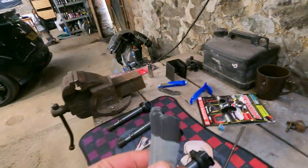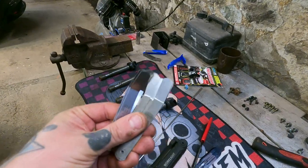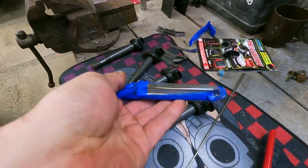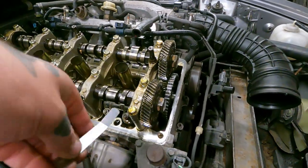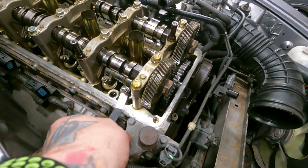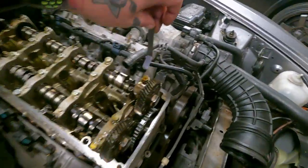You can just use a spanner and a screwdriver, but this makes it a lot more precise and you'll probably get it done a lot quicker. You're also going to need some feeler gauges — these here. If you can on the S2K, get your bent ones. They came in a pack with straight ones as well, but these are just easier because of the way the engine is positioned. If you were to try and get the straight ones in there, it would be a royal pain in the ass — with the bent ones you can keep your arms straight and the feeler gauge just pops in.